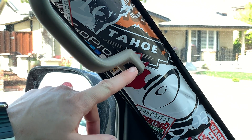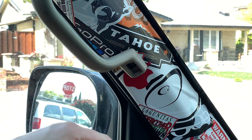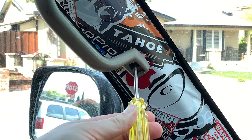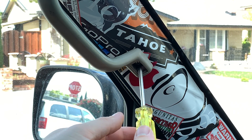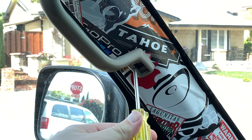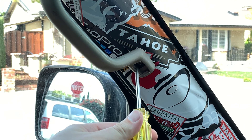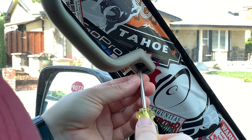If you've never removed these screws, click the link above to access a video where we use an impact driver — hammering it to tighten ever so slightly, then reversing and hammering to loosen. What Leon recommends to avoid stripping the screw head is to use a cordless impact driver with a number two JIS, not Phillips, bit — such as the Motion Pro JIS crosshead hex drive bit or the Makita impact bit, which we'll list in the video description.